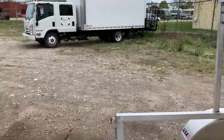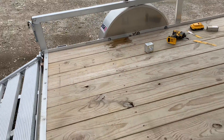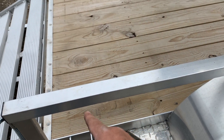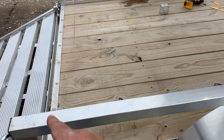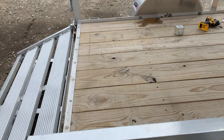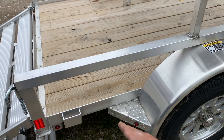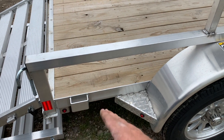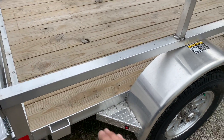I'm going to come out and run into two posts that come up off of there as temporary supports, because I'm going to cut this back off here right at that point and come up to this point. I'm going to reinforce that and make that an angle, take this floor out so that I have a departure angle that's much steeper here. It'll come up off of here and go up to there so that my departure angle will change drastically by taking that back section off.